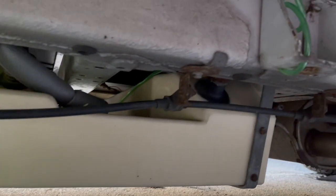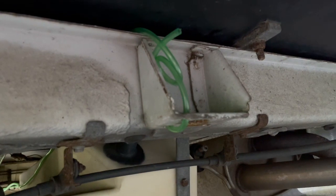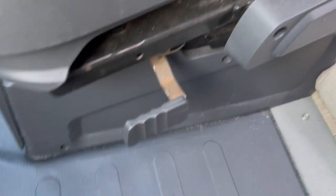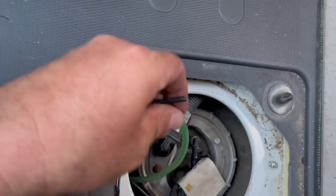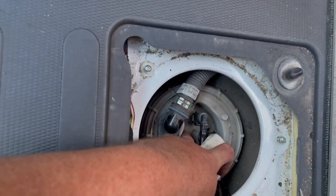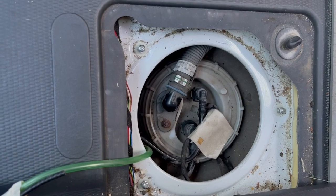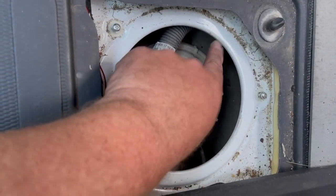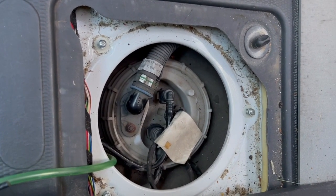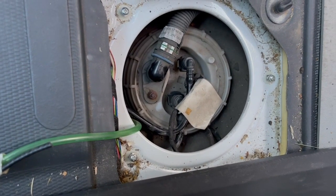In the cab there's a little square access panel that just clips in, and a cover that's screwed in place. As you can see, the fuel pipes are right there. I'm hoping to tap into the fuel lines between the two pickups - I'd love to tee into them - but I don't want any difficult starting issues. So I'm going to look at what others do with that. I'm not really wanting to drill into the tank. That square hole should be big enough to get the fuel line through.